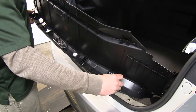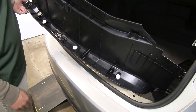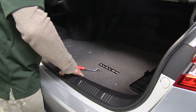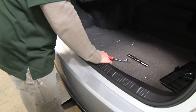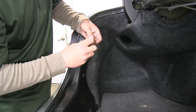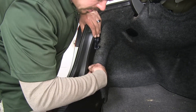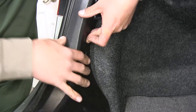Take the push pin, find the little ridge on it, and slide it back onto the panel itself. To get the threshold back in you may have to lift up on the floor covering a little bit. Get everything lined up and go along the edge pushing it back in place. Push the tie down hook back in and replace the push pins — push in the outer section first, and once it's lined up push in the center section to lock it in place.